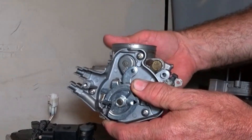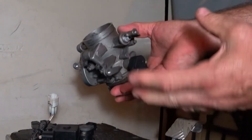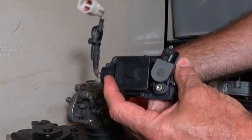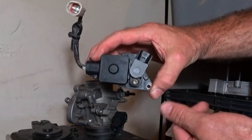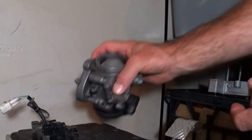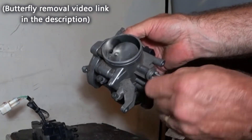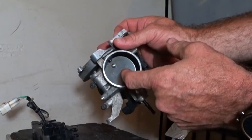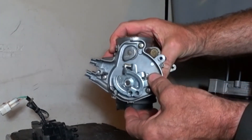Another thing while you're in there that will greatly improve the way the bike rides: you can see this butterfly is obviously controlling incoming air. The ECU needs the motor to be there — it's programmed to watch for problems with the motor, and to that end it has a secondary throttle position sensor. It also checks the voltages and resistances in the wires to make sure there's no problem. So if you remove it you'll get a fail warning on the dash showing an ECU fault. What we can do is undo the two screws and completely remove that butterfly plate, so the shaft is free to do whatever it wants. The ECU thinks everything's happy because the shaft's turning and it's getting readings, but this has no bearing on the incoming air to your motor. The throttle is controlled by you and your hand — whatever you do with your wrist is what the air does coming into the motor.